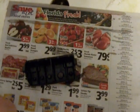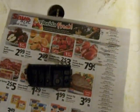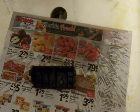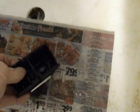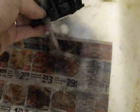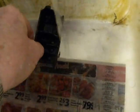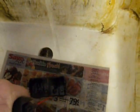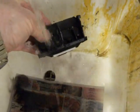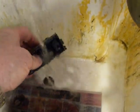I've got some newspaper down on the bottom of the sink. I'm going to turn on the hot water and get it as hot as I can. The newspaper is there so I don't damage the bottom of the sink. I'm going to let that hot water run — if it's too hot, hold the printhead with something — but you want it as hot as you can. Then as I do that, I'm going to blow the air through the nozzle. Keep running that water through it — that'll clean it out.